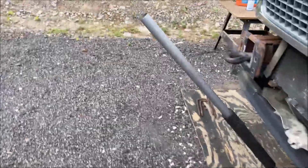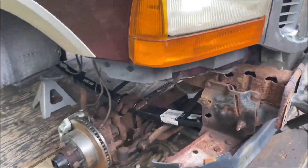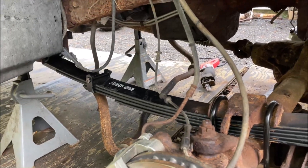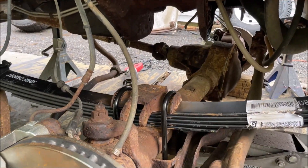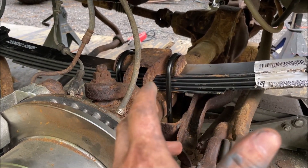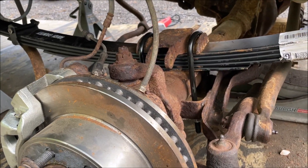Got all the hardware, all the shocks, and one leaf spring so far. What I did today: I put on the one leaf spring that arrived this weekend — center bolt aligned, u-bolts snug, leaf tight. I know I'll have to loosen those u-bolts again once I get the leaf for the other side, but I just want to get it on the centering pin so it won't move overnight.